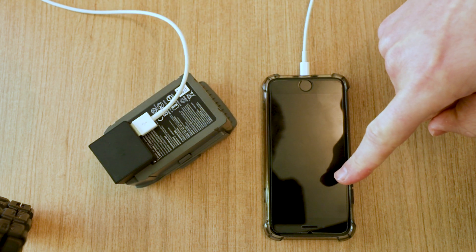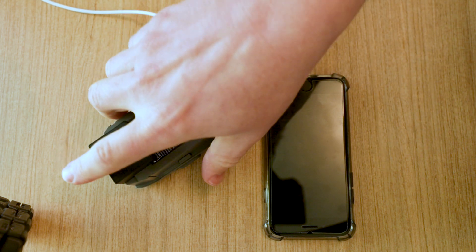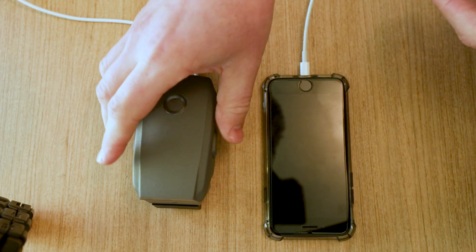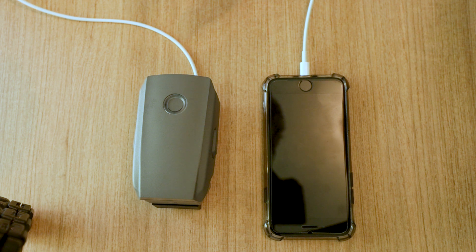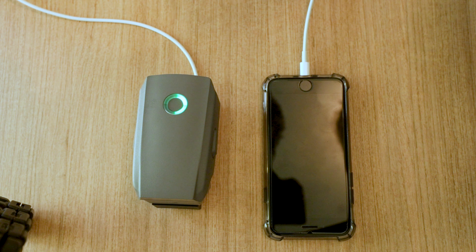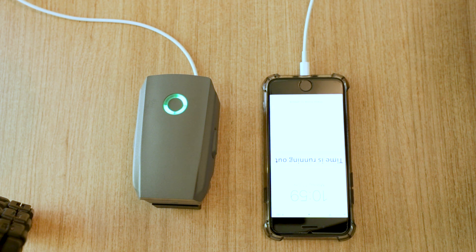Notice on the phone here it's not actually come up as charging, so what you actually need to do to turn on this adapter is just flip the battery over and turn on the Mavic 2 battery. To do this, just tap once, and then tap and hold. And you can see now the phone lights up and starts charging.